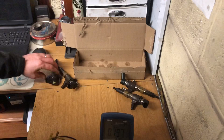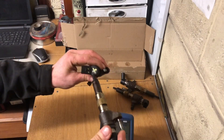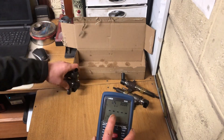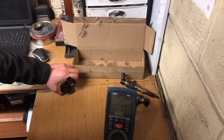But live on camera, that actual one did the exact same thing - I could hear a noise out of the internals of it, and the resistance I should have had of about 0.2 mega ohms was just zero. Shorted out windings on two injectors are definitely faulty. This would probably explain why I had four fault codes for four injectors - I was presuming one was actually failing internally and that was making the ECU try to compensate for a short happening with the injectors. But I changed all four because it's quite a common problem on the 2012 Ford Focus.